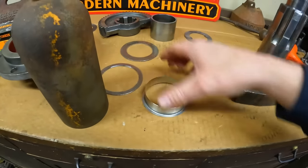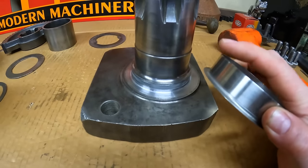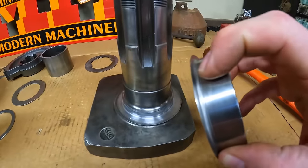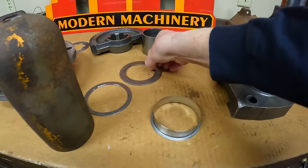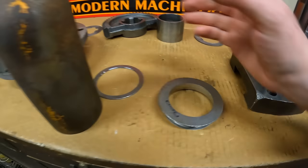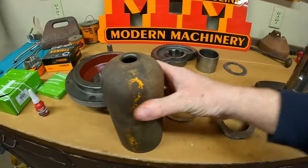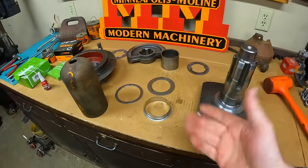I'm going to drive this on pretty much until the flange contacts, but then I want to get the rest a little bit deeper because we don't have a lot of vertical real estate there. When we pull that flange off the bottom, that's going to take about a third of it away. So the next washer will go on top of what's sticking up once I pull that flange off, and then we can drive it the rest of the way with our special service tool. It just could not have worked out any better — at least on paper. Let's put it into practice.